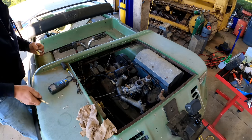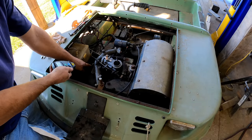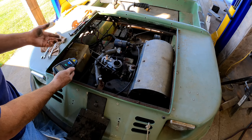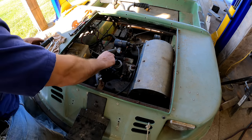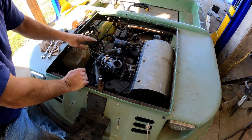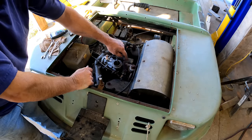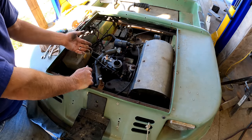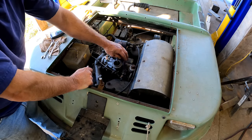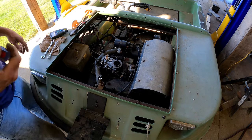What I am going to do is check the RPMs with my RPMometer. I didn't get it on film, but I was checking the RPMs. I've got a piece of reflective tape down there on the crankshaft, and it's idling at 1900. It should be 1200. When I turned this down and held it back, it is where I suspected it should be, where it sounds good, where the belt comes all the way up, is where it should be idling. This is hitting an endpoint, not here, but in the governor itself. So then I checked the high RPM, and it's only supposed to go to 3600, and the governor doesn't respond at all. So the governor's not working. I'm always hesitant to change the setting on a governor, but in this case, it's not doing anything for me.